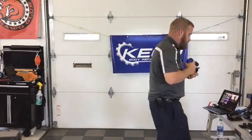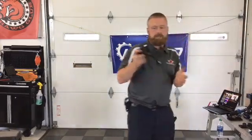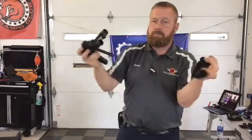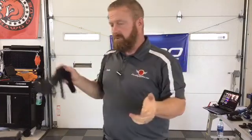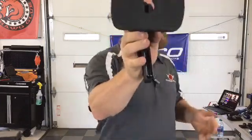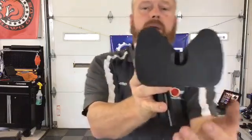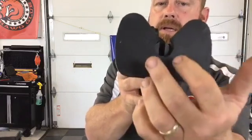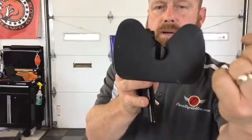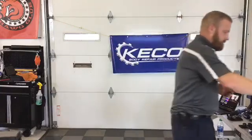If you really need to pin some metal down, we've got the precision plate. So same Robo body, pops right on and off. I like to keep 2 Robos around just for this purpose. This, let me get right in there. Right there will really hold literally all of the metal around there down and concentrate that pull. This pulls so hard, I'm able to pull sharper dents than I ever thought possible with the Robo. We're still not done with the Robo though.